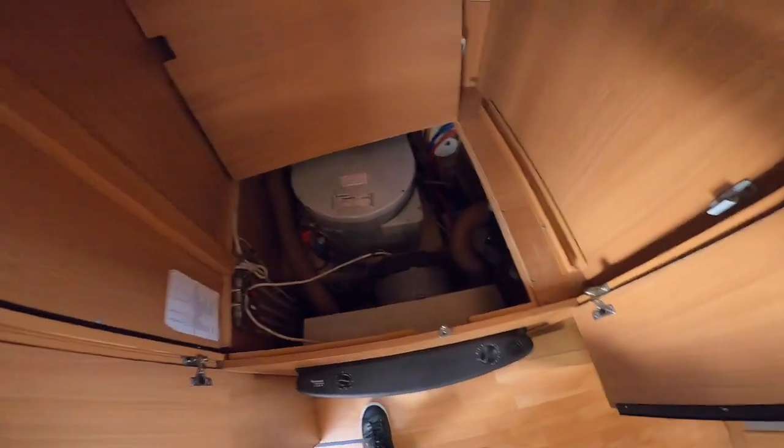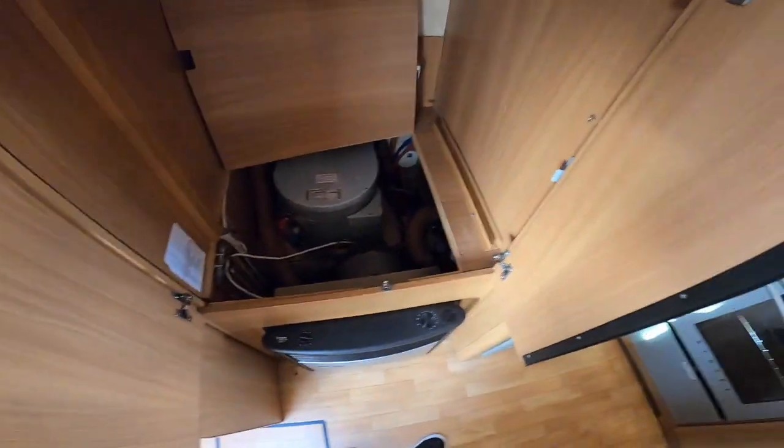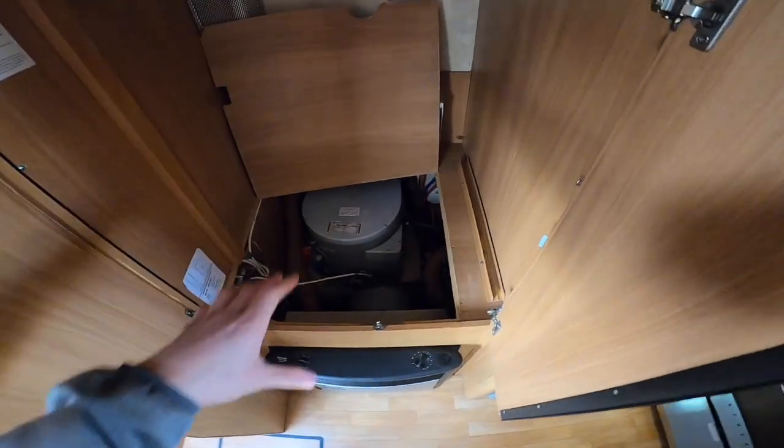So behind this pipe here you'll see a yellow toggle, and what that yellow toggle does is it drains the boiler off. So it's lying down now, so it's double jointed. When it lies down it's holding 10 litres of water. What you need to do is stand it up. The water will drain directly out of the chassis. Leave it stood up during the time you've got the vehicle in storage and not in use in the winter. This will stop the water from freezing.